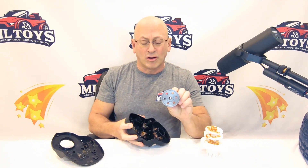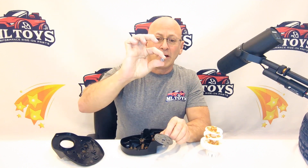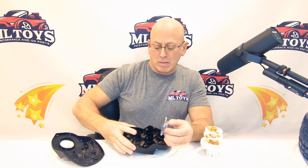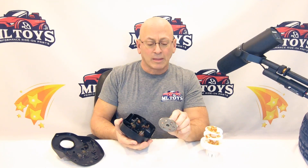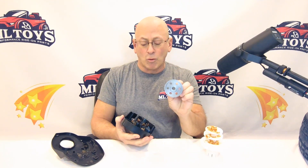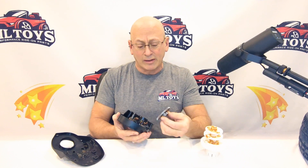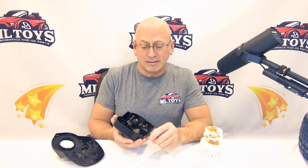For a long time now there's been a cure for that — the hardened steel first gear. This will also take care of the forward-to-reverse issue. The hardened steel first gears we make spin on ball bearings, and these ball bearings reduce all of the heat on that shaft so it's not a heat build-up issue — it spins smooth and round. The forward-to-reverse issue won't be a problem on the steel gear. You can still break the second gear if kids are driving improperly, but the greatest thing about that kind of failure is it's fixed by educating the kids not to shift gears without stopping first.